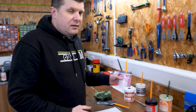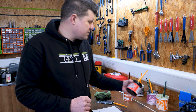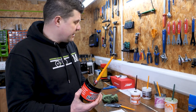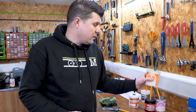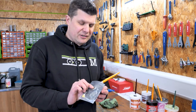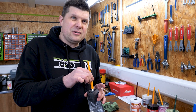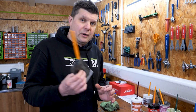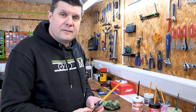This is a copper grease we use all the time on steel frames with aluminium bottom brackets — whenever there's a difference in materials. More recently we've been starting to use a calcium sulfonate grease, which is a bit more inert and can be used in quite a lot of different situations including nylon bottom brackets into carbon frames. But in this case the customer has supplied some nickel construction grease. This would normally be used in the aviation industry for high heat applications like jet engines, but it fits quite neatly in between the nobility chart, so it should work absolutely fine.